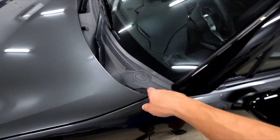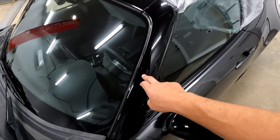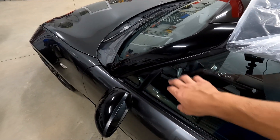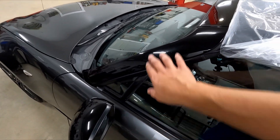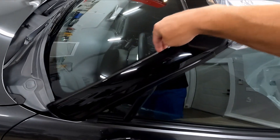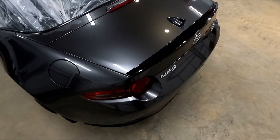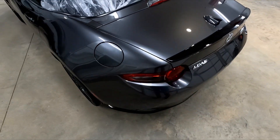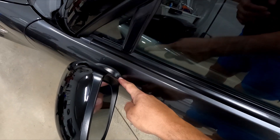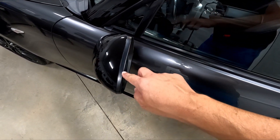So like this kind of stuff — this will look ugly. It already looks faded, so I'll have to do some reconditioning to make it black again. I need to polish this trim piece around the windshield — it's really scratched right in here where you would put your hand if you're sitting in the car with the window down driving; you can almost see some finger marks down there. So I'll have to tape off all of this trim on the inside and the outside, and the belt line trim all the way around. The lip spoiler I can polish out — that's painted. It won't hurt the tail lights. Around the mirrors, that's soft rubber, so I'll have to do that. I can polish out the mirror caps by hand, but I still need to tape off this textured plastic here.